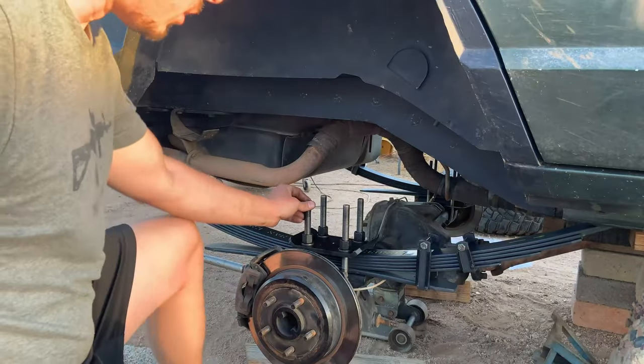I'm going to take a zip disc and cut these off, then bring you guys back. After going through about half a dozen Harbor Freight cutting wheels, it's time to double-check the bolts, make sure they're tight, make sure everything lines up, get them as snug as possible, then hit it with the torque wrench. Once you get all your u-bolts to that click, they are up to spec — 180 foot-pounds, not 150 — and you are done.